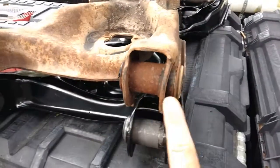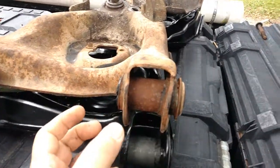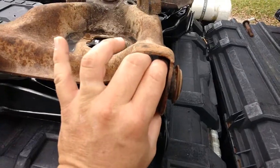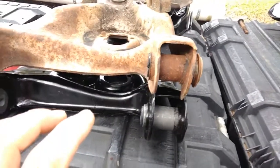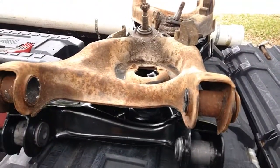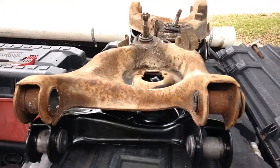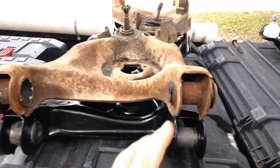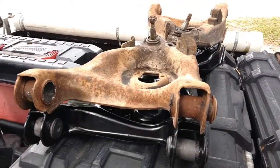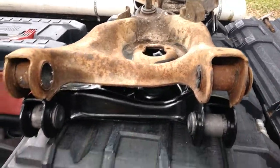This is where all the pushing force is applied and it just bends. Okay, so this is useless at this point. So there has to be something that goes in here and supports it, as well as probably between here. And that right there is why I'm assuming that a press machine shop charges you so much money to do this job, because these parts are so flimsy and they're going to bend and distort, and it's real quick and easy to mess these things up, so they're useless.